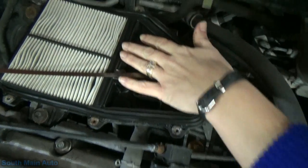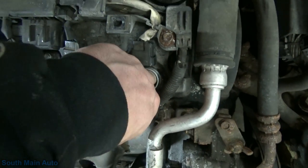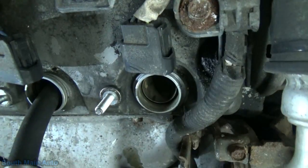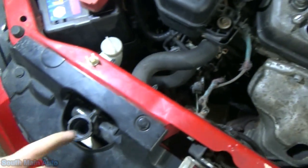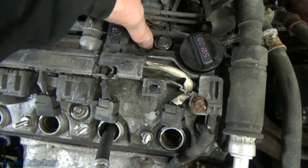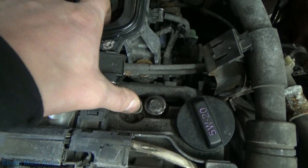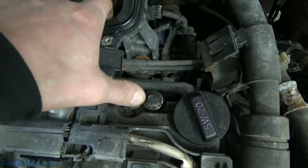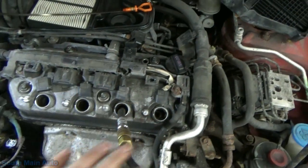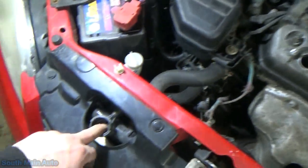Right there — it's leaking out the intake valve, and leaking out of number one. This old girl is leaking everywhere. Just a teeny tiny bit in the crankcase. The head gasket must be severely blown, or the head's cracked, something like that.